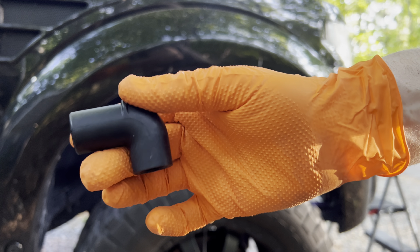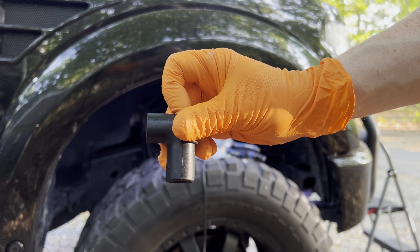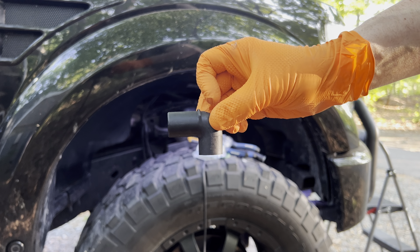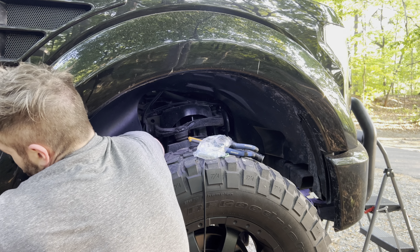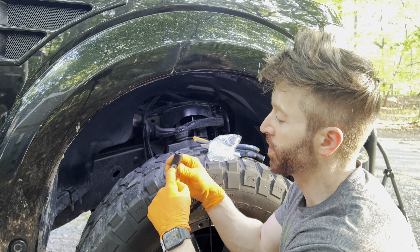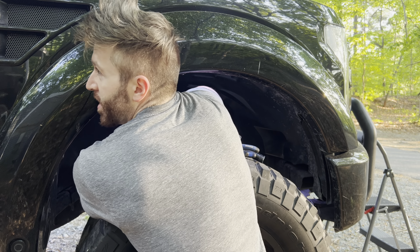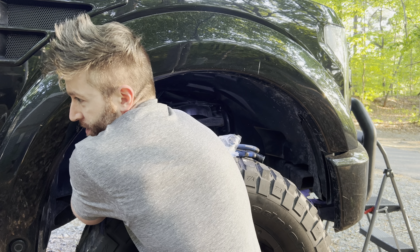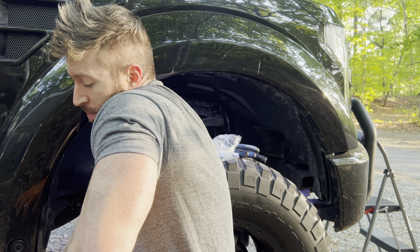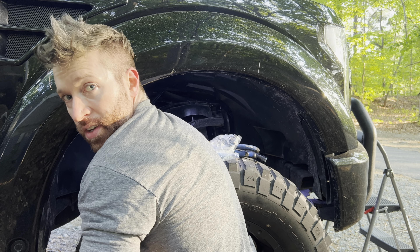So there's a long and a short side — from what it looks like the long side gets put on. It makes more sense because it gives the water a farther distance to drip before it can splash back up the drain tube. From what I've seen, you're supposed to put it on this way. One trick: take dish soap, put it on your finger, and put it on whatever gasket you're trying to get on — it helps out a lot. I want to make sure it's really on there so it doesn't fall off when it gets hot or wet. I think it's on.